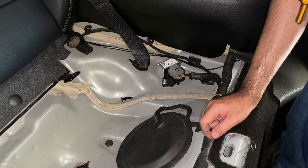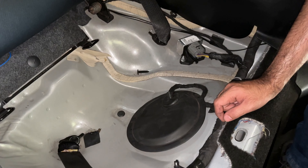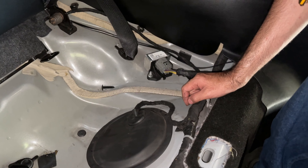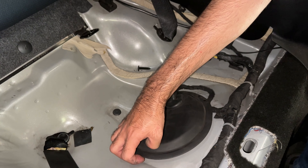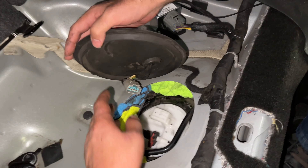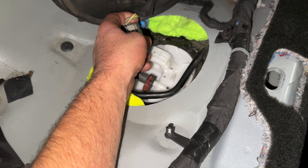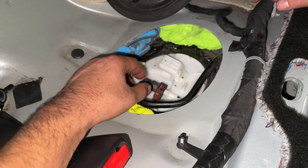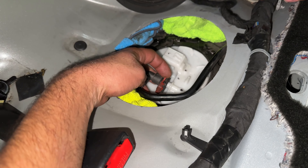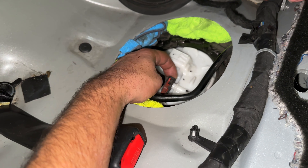To release the fuel pressure we have to refer to another guide — taking the fuel pump out of the back seat. You have two little locks that stick in your back seat, one there and one over here. Those two locks come out, you pull the seat out, and you have access to your fuel pump lid. Put your fingernails underneath one and pull up on it. You'll see the power cable connected to the pump — press the middle in and pull it out. Then you have the hose connected to the top of the fuel tank with a metal retainer — push those metal retainers up.